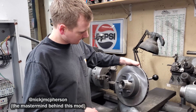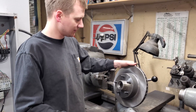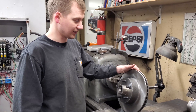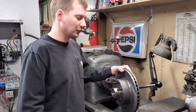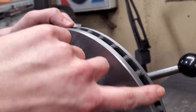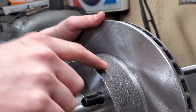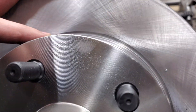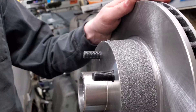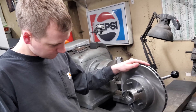This is the new front rotor — it's actually off of a '68 Mustang. But we had to turn down the outside on the lathe a little bit to clear the Toyota calipers we're running. So the outer diameter was shaved down a little bit, and then in this corner we had to face it a little bit to clear the inside edge of the brake pads. Let's see how it works — hopefully it fits nice.